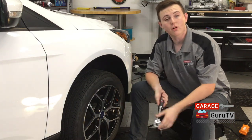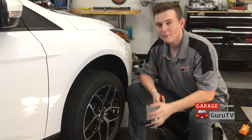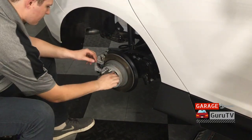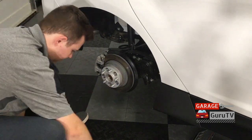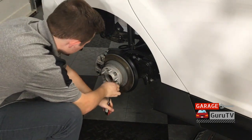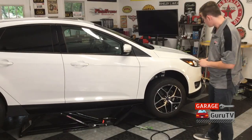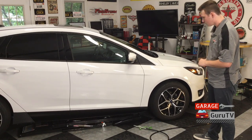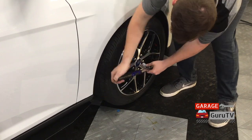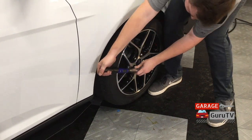Once you're done snugging up your wheels onto your vehicle with the new spacers, grab your torque wrench once you drop your vehicle down. Don't try to torque your wheels when they're up in the air because it'll just spin the wheel. Once it's on the ground, you can torque them to your OE spec and get driving on the road. Repeat the same process on the other three wheels. When torquing down the rear spacers, you do not need to put a screwdriver in the brake rotor as the parking brake will hold the rotor in place. Once your vehicle is on the ground, torque down your lug nuts to the OE spec — in our case, 90 foot-pounds. I torqued our wheels in two stages starting with 50 foot-pounds and then 90 foot-pounds.